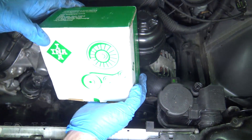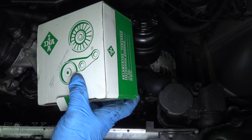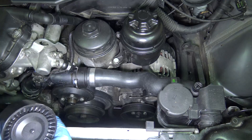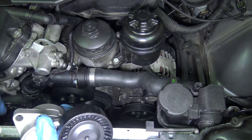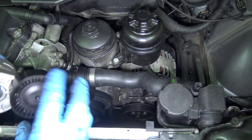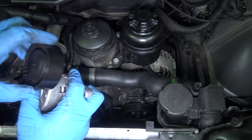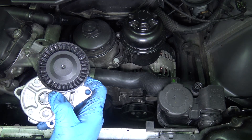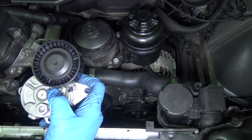The OEM brand is INA. I did buy an aftermarket brand first and when I opened it up and spun the pulley, it had a little bit of noise. So I sent that back and got the INA one. I didn't get an INA one for the AC tensioner because that pulley sounded okay — it's just a pulley. I did see one seller on eBay that sells just this pulley, and I'll put it in the description if you just want to change the pulley — all you have to do is unbolt it and bolt a new one in.